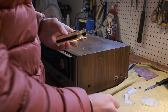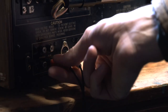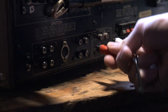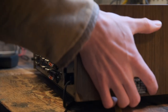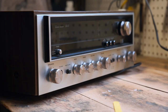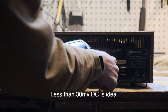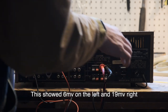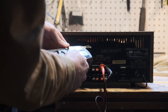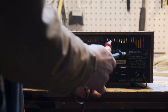Time to throw the wood case back on and do one last thing before plugging it in: clean the plugs on the back with some fader lube. Spray some lube in there, spin the plug around a few times, pull it out, and move on to the next port. Give it a few minutes to dry up, wipe off anything left, then a few more minutes before powering up. And man, that looks great. The last thing to check is the DC voltage at the speaker terminals — you want both left and right under 30 millivolts. Higher than that can damage your speakers and can also signify something wrong with the receiver. In this case they were both very low, so no problem — but always check that before connecting any speakers to a receiver you pick up.